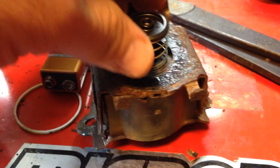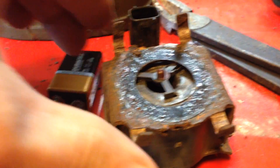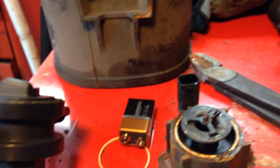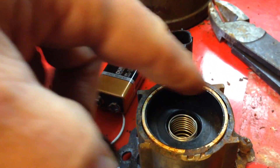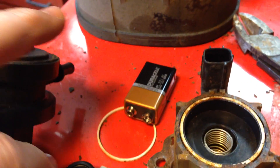I took it one step further — this is your plunger, that's what cuts off the vacuum going to the canister. I took off this metal piece, and then you just have this other plunger. There must be some windings down here that energize this — it must be what energizes the coils to move up and down in the shaft. It goes in here like this, spring-loaded, so when it energizes it sucks it down, and when it de-energizes it pushes it back up.